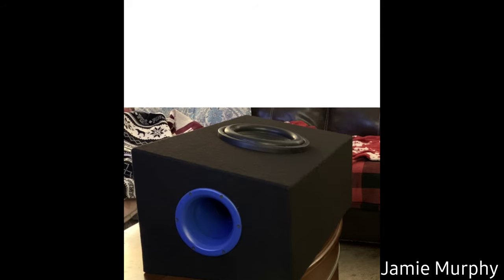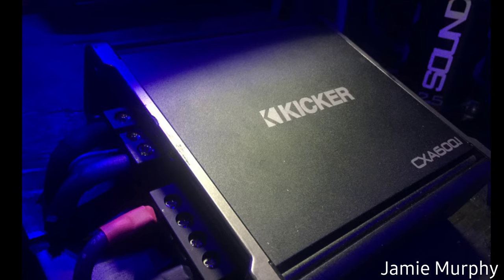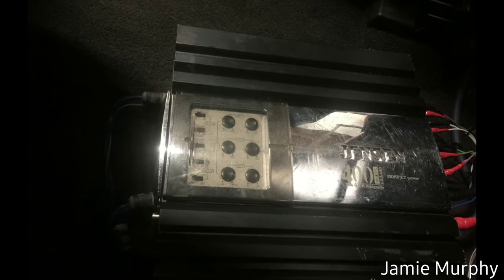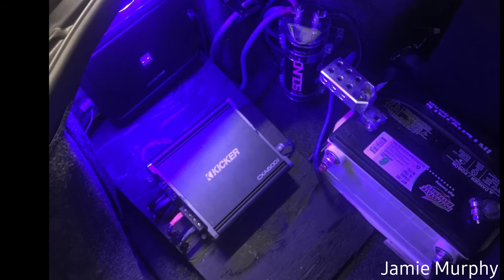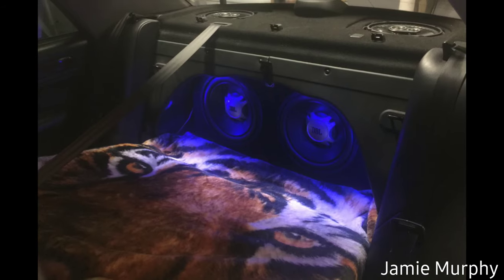All right, so coming up for the first car system on Subscriber Showcase is Jamie Murphy. He has a 12-inch DVC 4-ohm level 2 DC audio sub and a Pro Bin Competition Bandpass ported box wired down to 2-ohm on a Kicker CXA 600.1 amp with 8-gauge Sky-High OFC speaker leads.